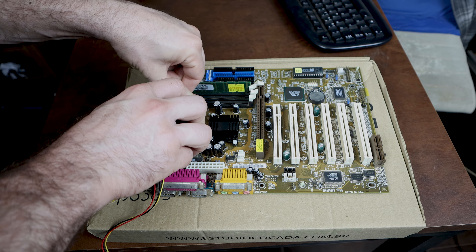Here are the main bits: the motherboard and CPU, the Voodoo 5, and the sound card. This is an Aureal Vortex 2 clone — it doesn't look brilliant but it sounds great, with good compatibility and the A3D audio API works great. Here's that trusty Voodoo 5, hopefully to go on for many years as a retro card. Two VSA chips, eight memory chips for a total of 64 megabytes — 32 megabytes per VSA chip — and a Molex connector for power, with a simple VGA out.